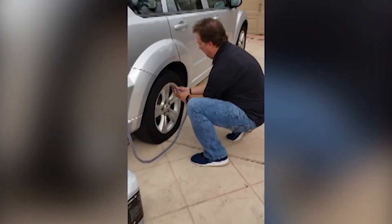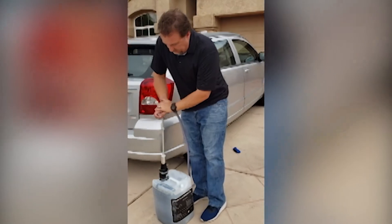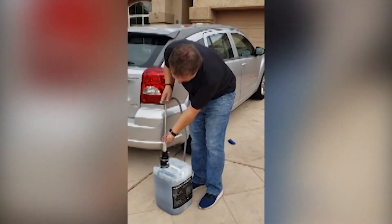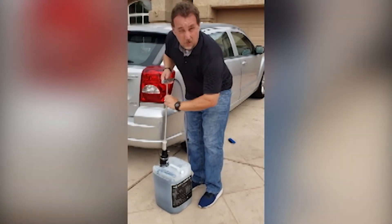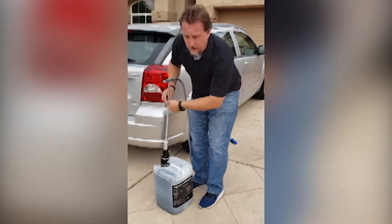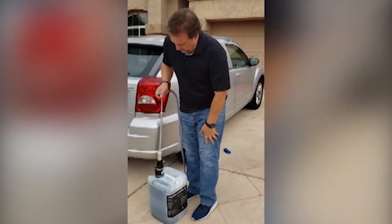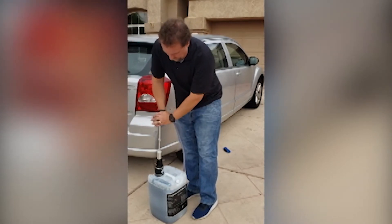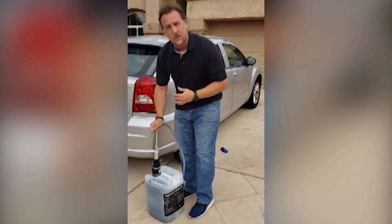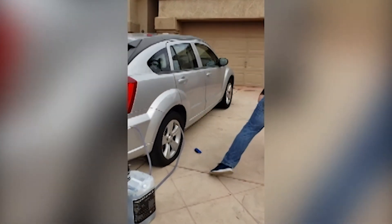Put the pump on the tire — there's a clip, undo it, push it down, and we're good to go. Now we pump in eight ounces first. There's not a lot of pressure to it. Then we pull back up and put seven ounces in by moving the washer — remember, the bottom of the washer to the top of the line. For 18 ounces, you would do six and three. Then pump the second load in. When done, pull up just a little to release pressure from the valve.